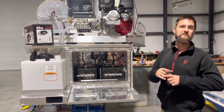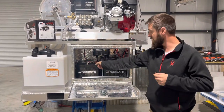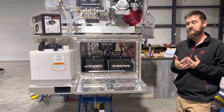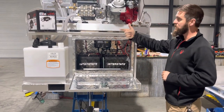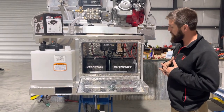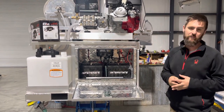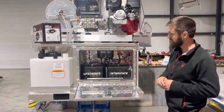Running those two batteries in series gets you to 24 volts. On the other side, you can run them in parallel and it's still going to be 12 volts, but you'd have double the runtime. I would do that because I don't like tying my system together at any point — that way they're completely segregated. If I have an issue, my other side is still good to go and nothing's intertwined. You'll need to drop at least one battery to get you to 24 volts — so you need two total. If you've got one, add one.